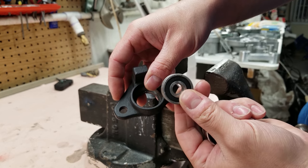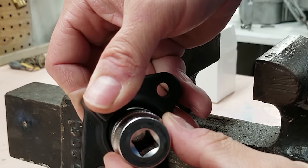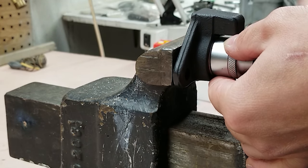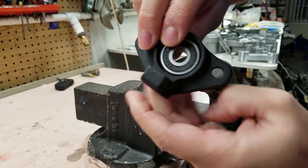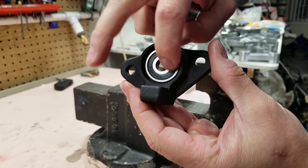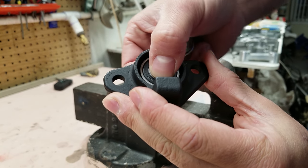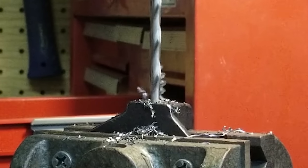We've got our freezing cold bearing here and a 22 millimeter socket that will fit on the outer race perfectly. We're going to do this the simple way - just put it right in the vice and press it in. The original spherical bearing that was in here was 16 millimeters thick; the inner race of this bearing is nine millimeters, so I'm just going to put a spacer on the other side that is seven millimeters to make it just right.